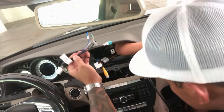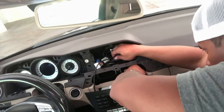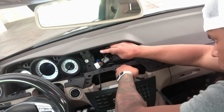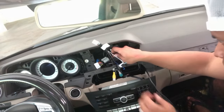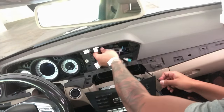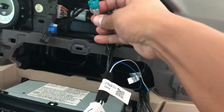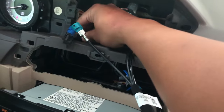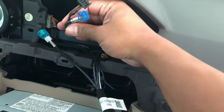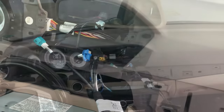I'm fishing the cable through the right side until it comes out of the center hole and pulling it through. The cable end has a Fakra connector — you're going to plug that to the blue connector that was pulled off the original screen. Don't worry about the black connector, we're not using that at all. Go ahead and connect those two Fakra connections.